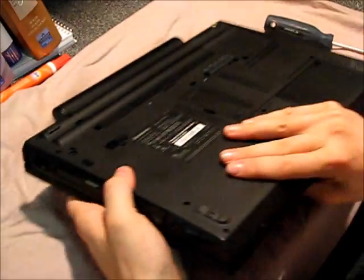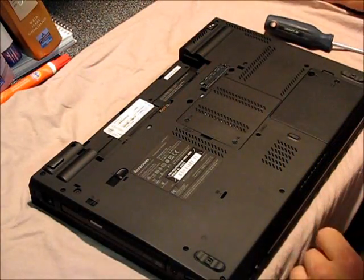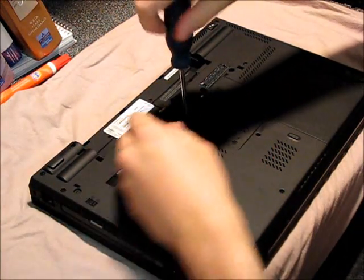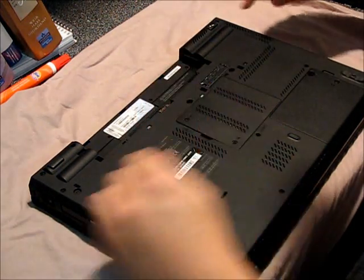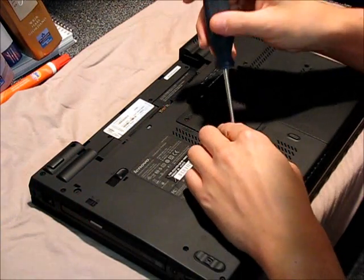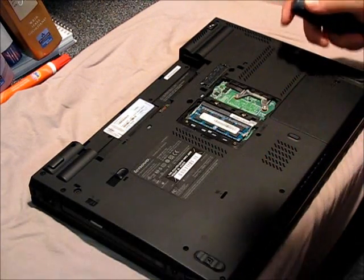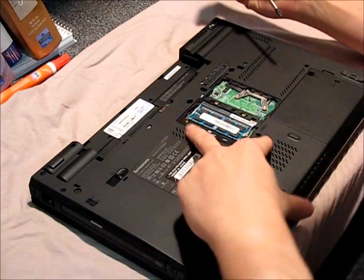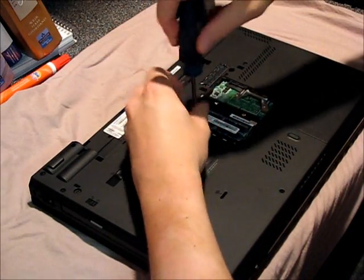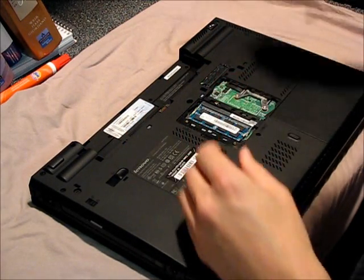Let's see if I can remember how to do this. Let's start by pulling the battery out, obviously. As far as I know, you basically pull every screw out of the back here, except for these two corner ones. I'm going to start in the memory bay — put that aside — and there are two screws here to remove the keyboard: one just beside the bottom DIMM and one to the forward side of it.